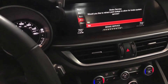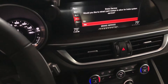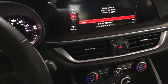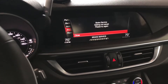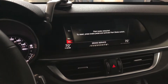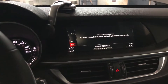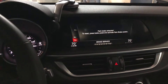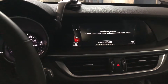We go back to Brake Service, and yes, we want to retract the park brake. It's making the noise — it's retracting. It says 'Brake service settings not saved, please try again,' but then confirms park brake retracted. So we're good, and we're gonna go ahead and replace the pads like a regular car. After that we have to come back to the car to finish the job.